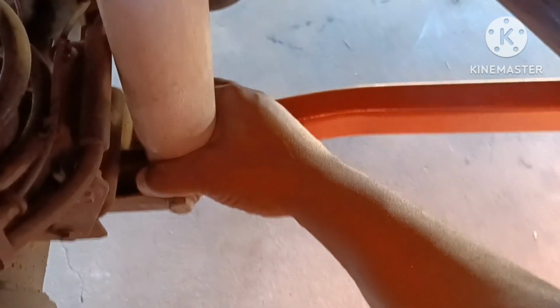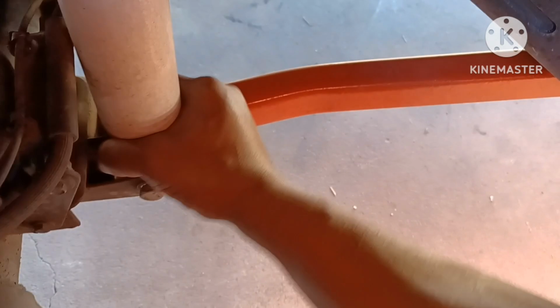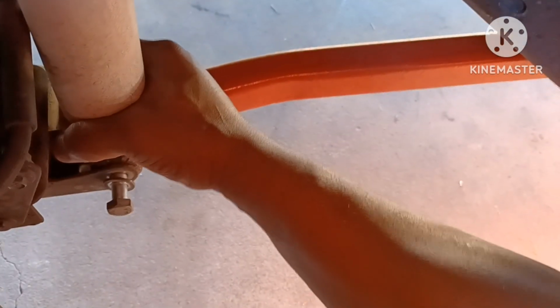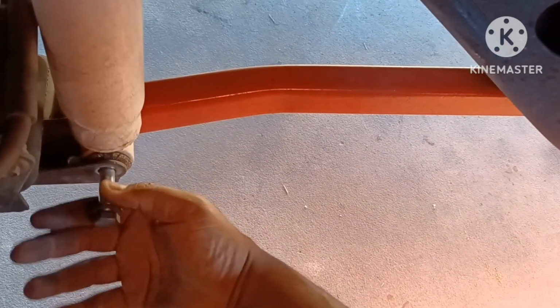Right now, the weight of the Jeep is pushing on it. So let me get a mallet. I'm gonna get a mallet, tap that out. I thought I could just kind of push up a little bit and push out. But there's one of my lock washers came off there. Let me see if I could do it. There we go. So that's what I do. I kind of pull up a little bit and this should slide straight out. Just the weight of the Jeep is on it right now. And so once this comes all the way out, the strut should fully compress. You can just pull it out real quick.